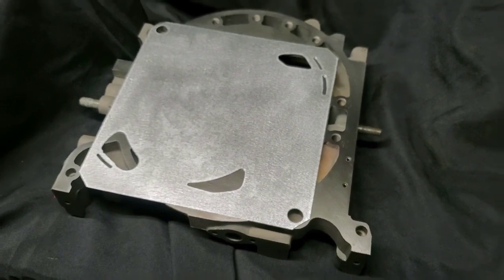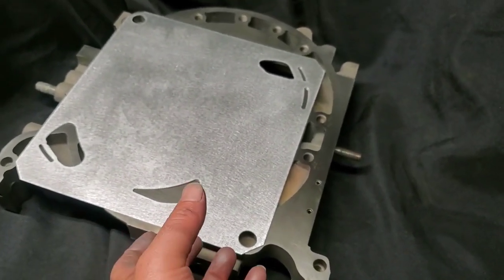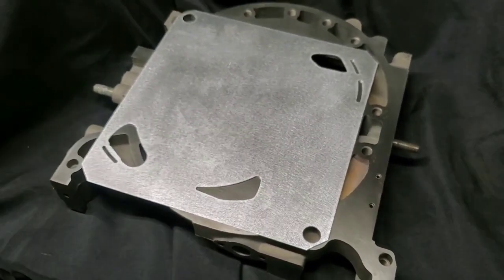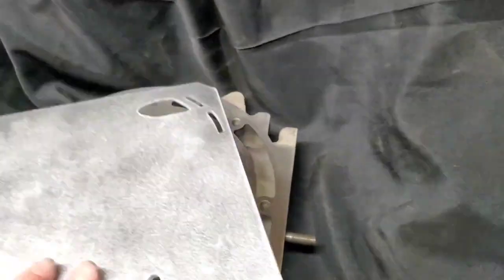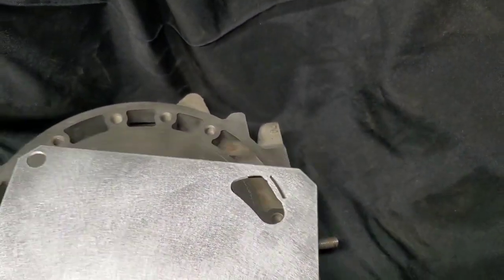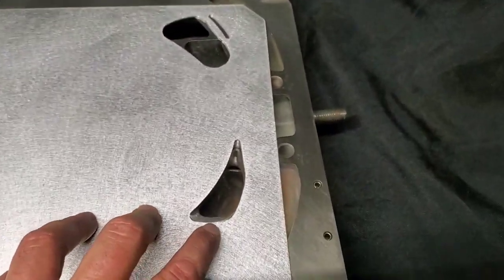And if you're going with a hybrid, you obviously would want to go with an RX-7 height apex seal, because that would be passing over the traditional RX-7 exhaust port. Back to the point of what this Renesys template is doing — it is opening up our exhaust quite a bit, so you're getting a nice benefit there.